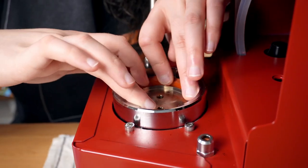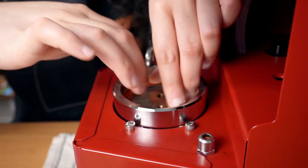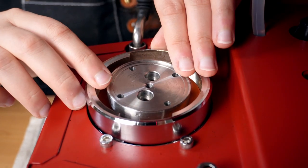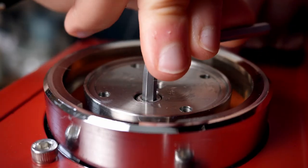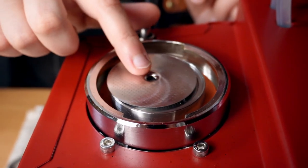Let's reattach the gasket, and this is a perfect opportunity to replace it with a new one if you saw that it was broken, for example. Then align the shower screen and keep it tight. Finally, set your shower screen plate and screw it all together.